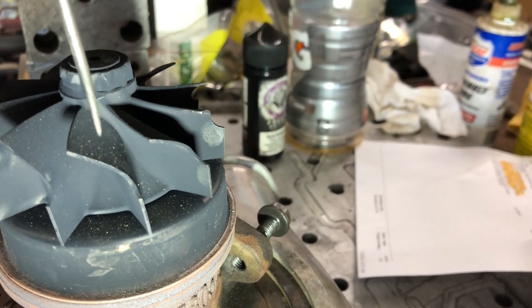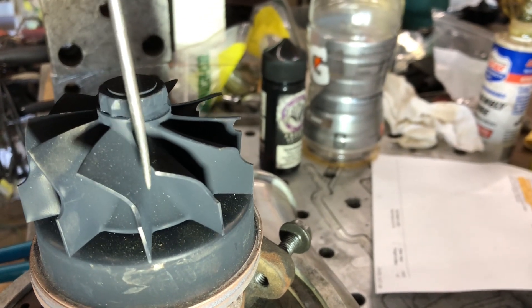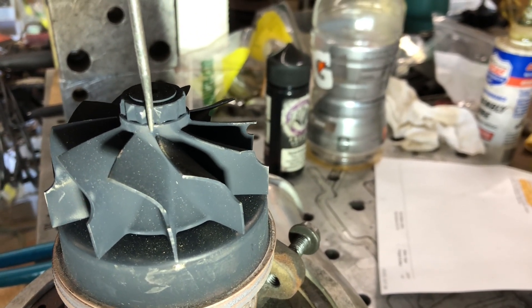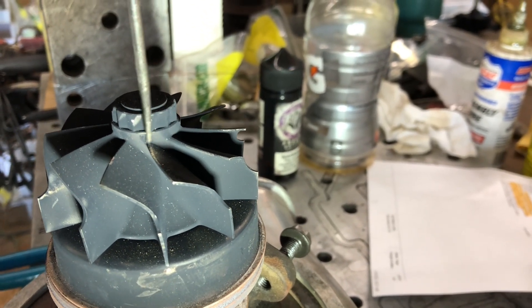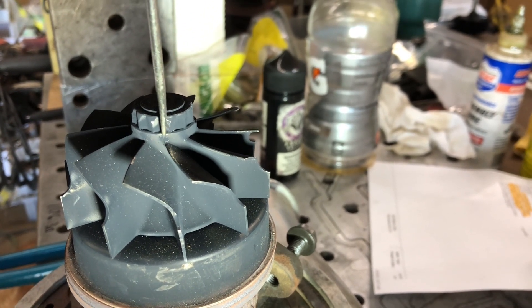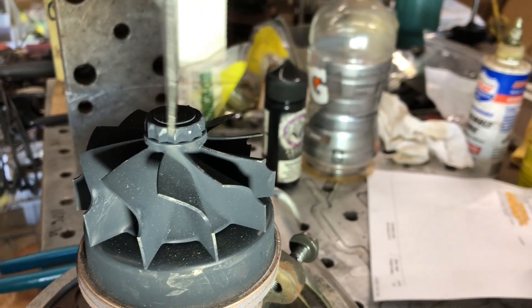Where it's darker is lower velocity, higher pressure. You can see the same with compressor wheels on anything — this is a fingerprint. See how it's sticking right here? This is a turbulent zone, just like how air comes off the back of your car — it's coming off the back of this ridge, and there's a low-pressure, high-turbulence zone causing the soot to stick there.